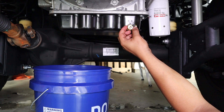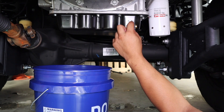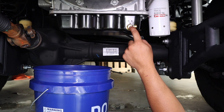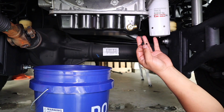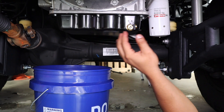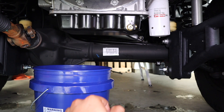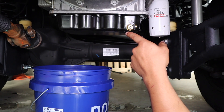Next time I do an oil change, all I have to do is open the oil cap up top, remove the safety clip, attach the clear hose, flip the valve down, and it'll start draining — probably 20 to 30 minutes. It's pretty simple and makes oil changes much cleaner and easier. I got one drip, but I usually put down a drain mat — not sure why I skipped it this time. That's pretty much it, guys. Let me know if you have any questions or comments below.